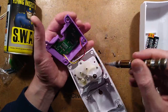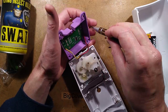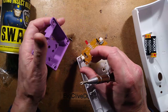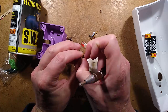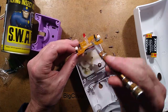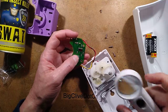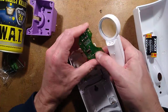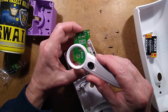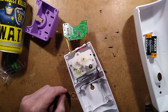Let's take the circuit board out. It's worth mentioning there's a separate switch down here to kill power to the unit — quite unusual, I thought they might have put that on the circuit board. So what do we have? Just the switches and the capacitor on the front, an LED and photo sensor, a transistor that switches the motor, and a chip. The chip number is HR8012CN. A search for that in Google brought up absolutely zero, which is very unusual — I don't know if that's a custom chip or not. I shall investigate it — I'll do the usual reverse engineering and be back in a moment.